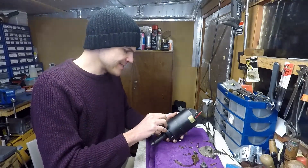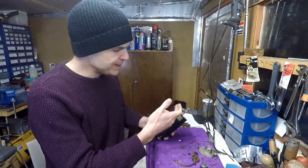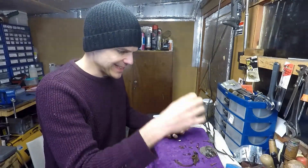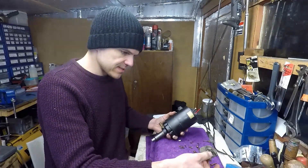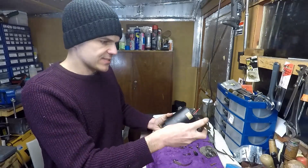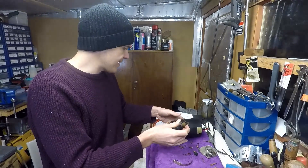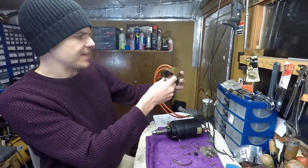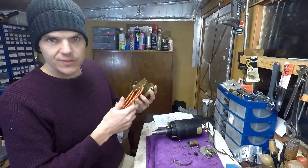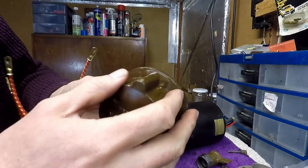There is a little pin here that you need to insert. What I need to do is build up the breaker plate so that the cam — if I install this on top like so — this is going to be facing number one cylinder on the cap, in the direction of rotation like so.